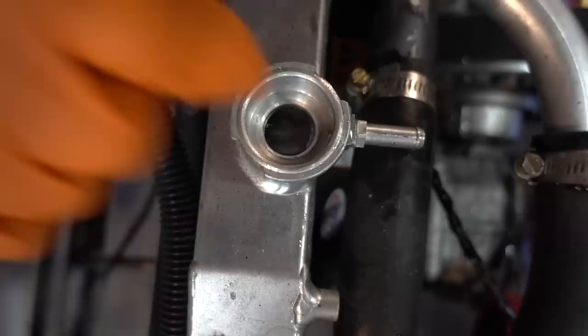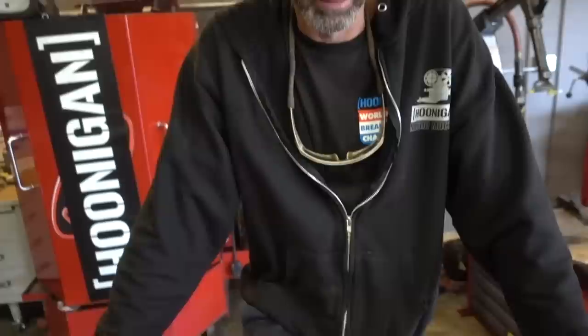Cool, man. Pretty chill day. Just carburetor, moving the front end. It's pretty intense to put the front brakes on a car that never had brakes on it at all, as well as just as intense as making these carburetors run correctly, because we got to guess on the primary jetting and then order the correct jets or drill these jets.